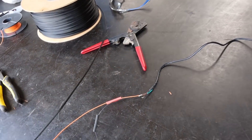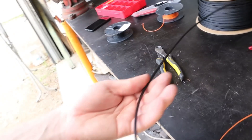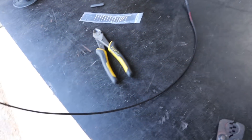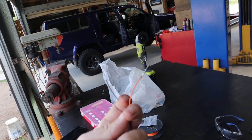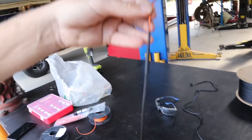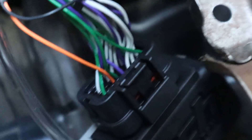Just working on our little sub loom for the wideband into the ECU. As always — open barrel crimps, good heat shrink, good braid. No excuse in this day and age for doing shitty wiring on cars. TFX wire, open barrel crimps, good crimps — we've got the Haltech crimp on the end. The other one's an earth and I'll hijack another earth in the ECU loom. That'll give us the wideband input. We're all wired in — on the dyno ready for tomorrow.